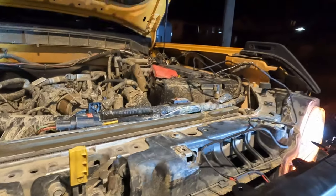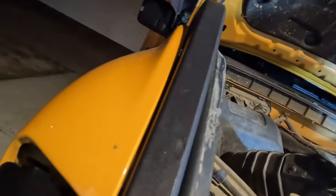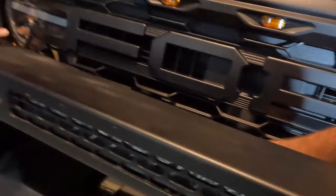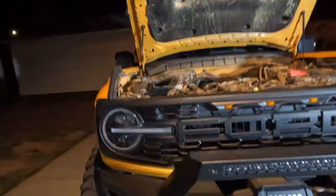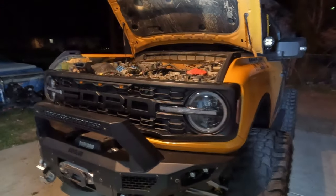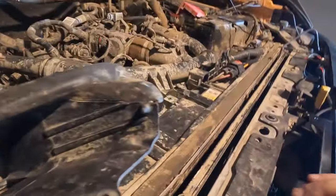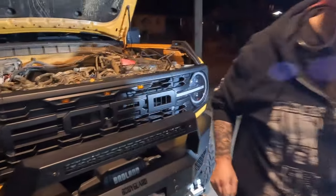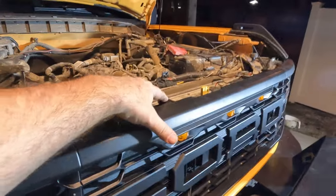The lights work, so hopefully everything else lines up and it should just snap into place. There we go — it's snapping in. That's much better than I had with my grill because it actually snapped in. It's got the screw holes at the top to put those screws back in so you can't just yank it off the Bronco. Let me just put those 10-millimeters back in and set the piece back in there — it's even got the tabs to reattach as well.